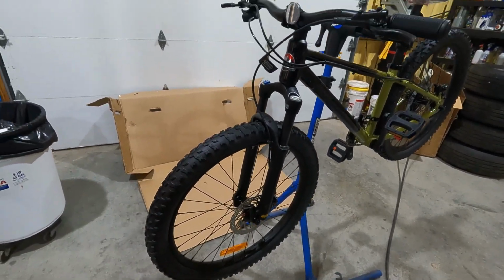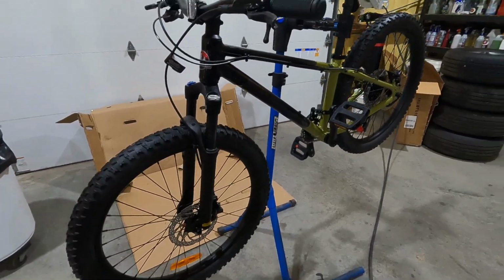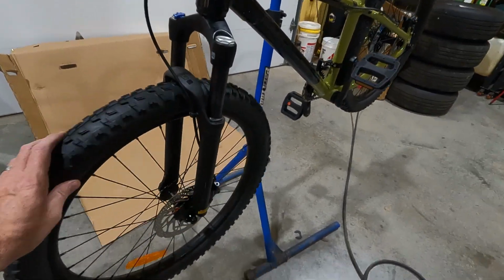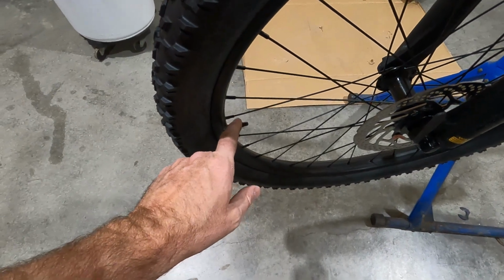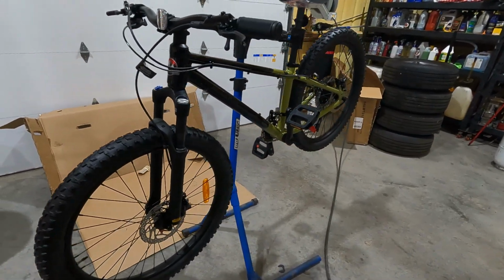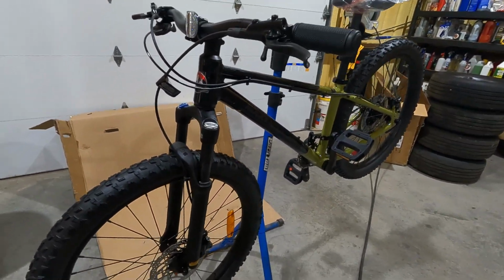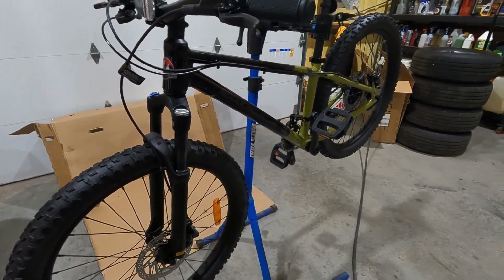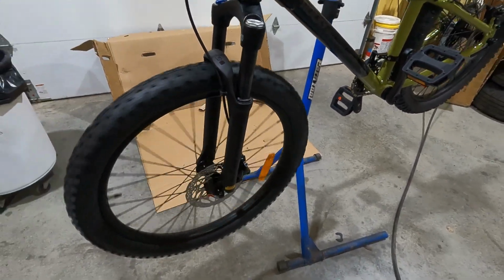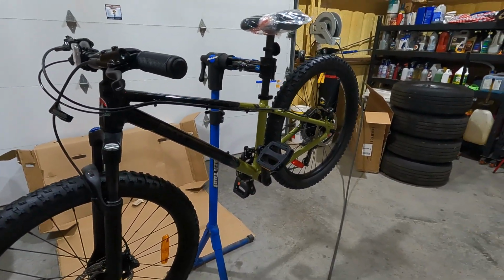Tubeless rims. All you got to do is get good tires, sorry. Get some good tubeless tires, and a tubeless kit, you know, to convert it to tubeless, because this stem belongs to the inner tube that's inside. So you're going to get a tubeless kit, some slime, good tire. You're going to shave 2 pounds off the bike at least, and yeah, it's awesome. Good Shimano brakes, man. They feel great. They are just, I mean, they are just buttery, man. Love it.